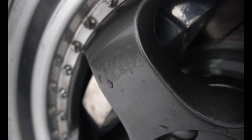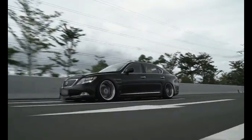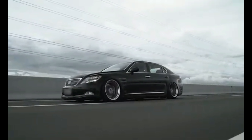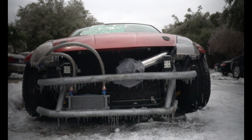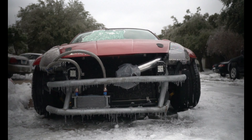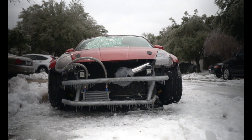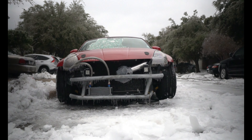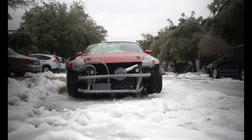There are a lot of options when you want to upgrade your brakes. I just chose the Lexus LS460 calipers because they were available and I wanted to see if they were going to work. Lots of people have used calipers off SRT8s, CTS-Vs — those are Brembos — and Porsche Cayennes, which are also Brembos, but I think they're either 17Z or 18Z in the front. There are a whole lot of brakes out there if you want to try it.